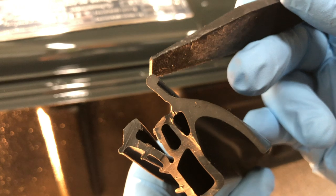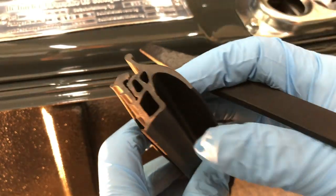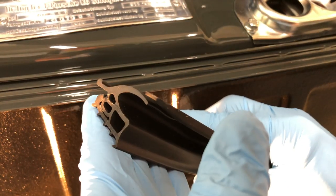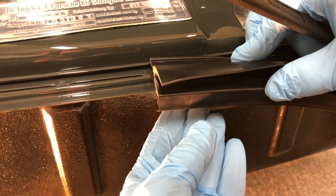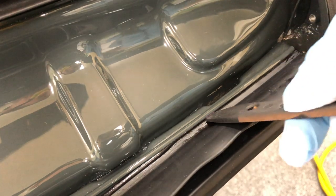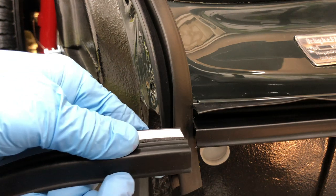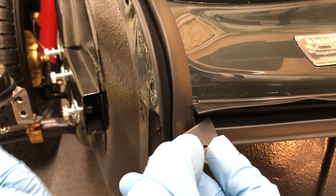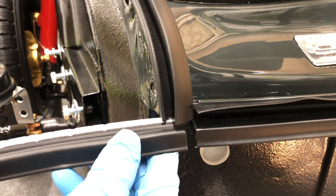Looking at our profile here — the front leading edge is going to tuck right into this area. A little red rubber grease will help slide that in a little bit easier, using a plastic tool so we don't damage the rubber seal. The bottom edge tucks up underneath and is then held in place by the bumper seating up against it — it kind of just pinches in there. From the top edge that's going to lock us in, and the bottom side the bumper is just going to hold everything in place. Just applying a little bit on the leading edge, and it seems to press in there no problem. Then our fender seal is going to butt into here — this transition is where we need to trim our hood seal, right flush with that.